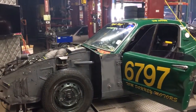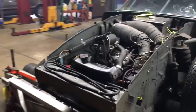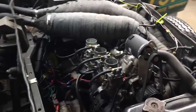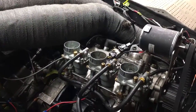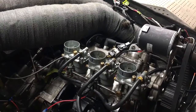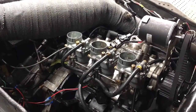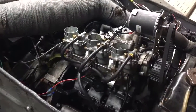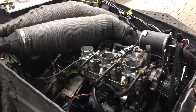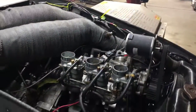I'm doing some testing today with my Bonneville two-stroke. I fitted it with the late-style Monte Carlo carburetor setup with 34W-2 carbs, and I'm having a little trouble just because my engine's so radical making everything work right. My primary goal here is I've got triple exhaust pipes — there's two there and one out the bottom — and I'm checking air/fuel ratio.